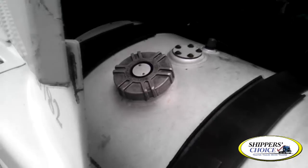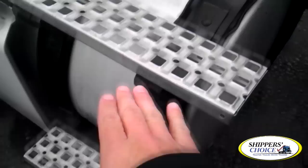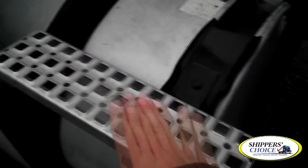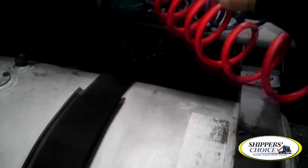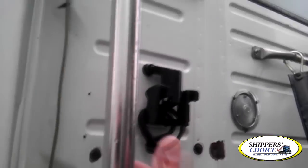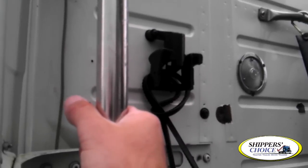We're going to move on down. We're back to the other fuel tank, which you said on the other side — so that's finished. We're going to get our steps right here and our catwalk. Even if not equipped with a catwalk, you still want to throw one in. They're not cracked, bent, or broken, no obstructions, no oil and grease present. Same for the catwalk — not cracked, bent, or broken, no oil and grease present, no obstructions. My grab bar is not cracked, bent, or broken, properly mounted and secured to the vehicle, no missing hardware, no missing screws.